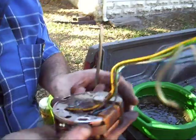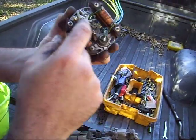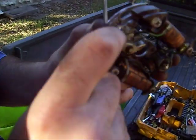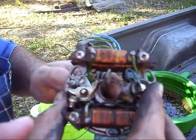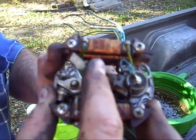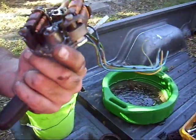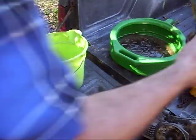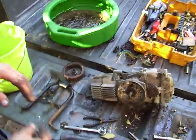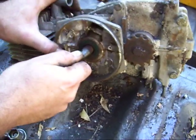We're going to slide our stuff out nice. This is the stator plate — everything is bolted to it, including your points. Here's your gap. Your crank comes through here and there's a lobe on there that pushes on that to open the points when they need to be opened. That's all there is to removing the front end. As you can see, there's quite a bit of rust on the inside of that crank — we'll have to take care of that. Here's the seal, and you can see how much play there is in the bearings.